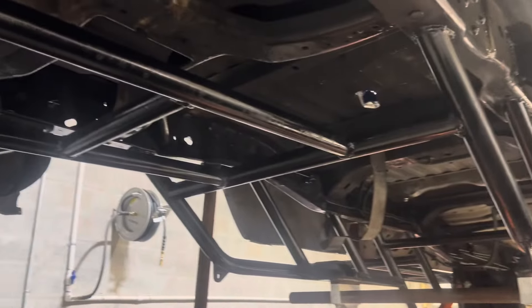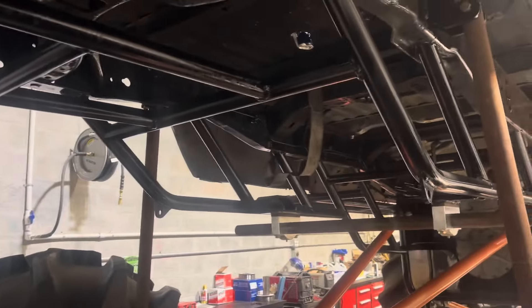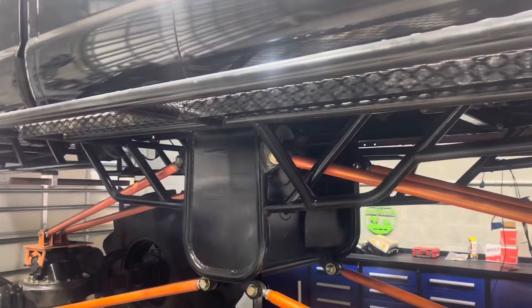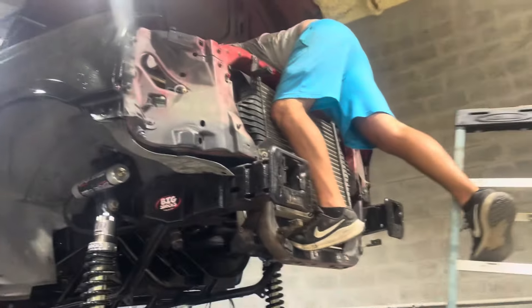We're back. I'll show you guys a little bit of what we've been doing tonight. I knew I needed a night to button up the frame. We've made support for our hitch slash pull point, and also to box the frame in — we put this bar here and that one across there, just because the sway bar is going to see a lot of brute force and we wanted to tie in the rear. Up front we don't have any, but we do have the trans crossmember welded in right there, and the motor crossmember. So it's like two and two, and in my head it works. Taylor's up on the ladder.